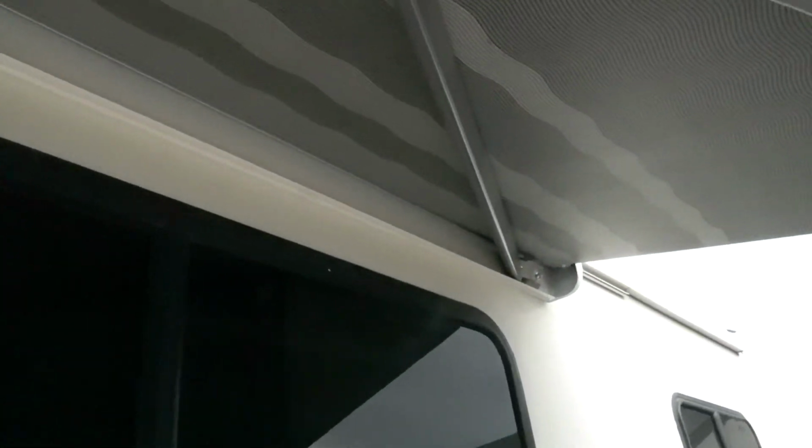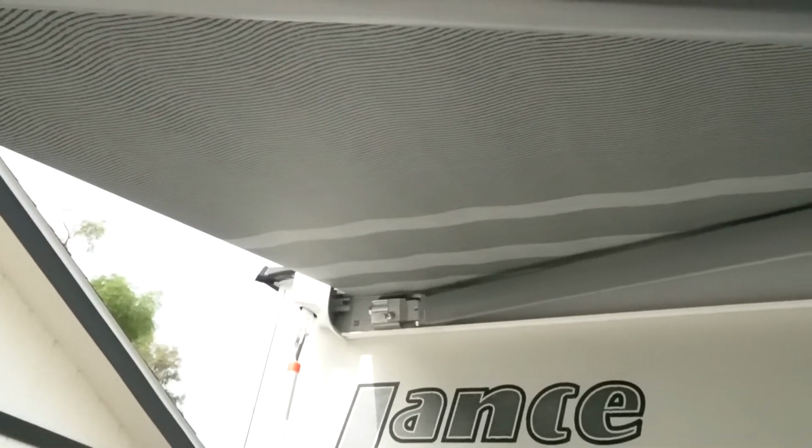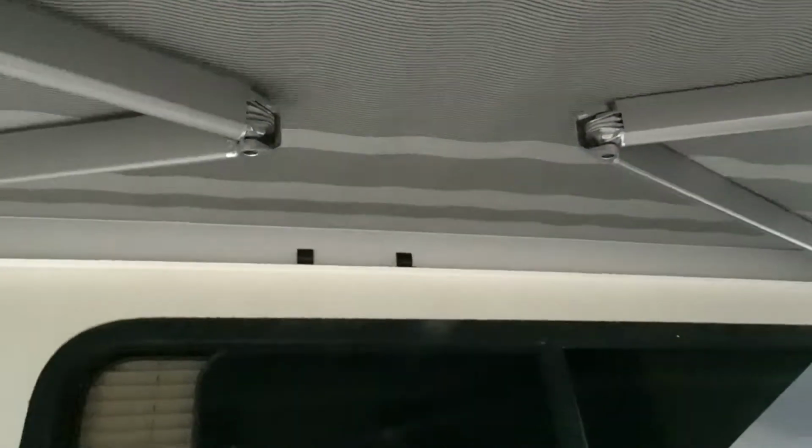I think it's going to at least work for a while, but let's say the screws come out, because there isn't really anything other than the fiberglass and foam on the other side to really hold the screws. I'm really relying on the lap sealant to do most of the holding. If they don't hold, then I'll remove these screws and drill holes that go all the way through and put some lag bolts in it with nuts on the other side.